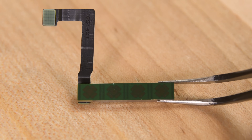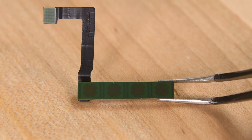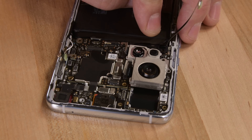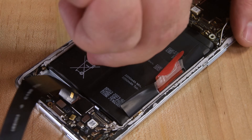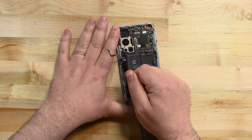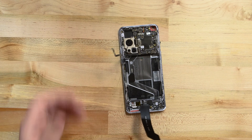These rectangular green caterpillars allow the OnePlus 9 Pro to support both the sub-6 and ultra-fast millimeter wave flavors of 5G. The main camera system is in our sights, but a sneaky cable prevents us from getting them all the way out, so we decide to make some room by removing the battery. OnePlus has pretty consistently used large pull-tabs on their batteries, making removal slightly easier than some other manufacturers, and thankfully the 9 Pro continues that streak.